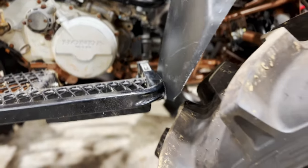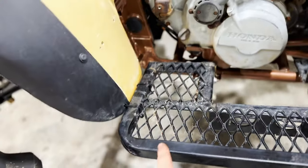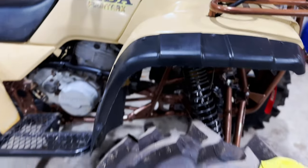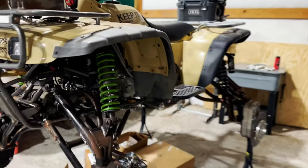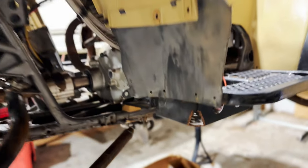I just want to show you how to trim it. To clear these tires you have to have the Strong Made floorboards. Take your supports out — I zip tie these, which I know looks a little janky, and then a self-tap screw with little washers into the Strong Made floorboards and it's not going anywhere. Here's what the stock side looks like that needs to be trimmed — you can see it's rubbing. This was on a six-and-a-half to seven inch lift; this is an eight inch lift, ten inch stretch. I actually had to cut the Strong Made floorboard.